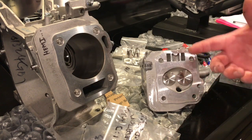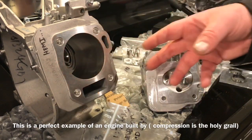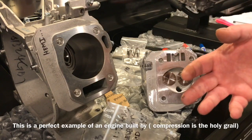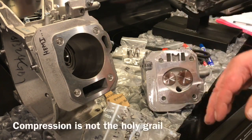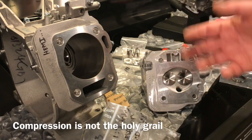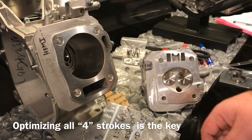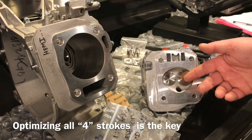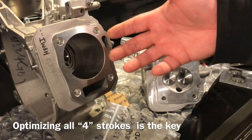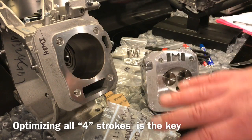Everybody just thinks about flow as air, getting that air and the fuel mixture down into the bottom of the cylinder. That's what gives you horsepower, being able to fill the cylinder, because at a high RPM, basically the engine just runs out of breath. Being able to get that air deep down into that cylinder better is how you create horsepower, because at high RPMs, if it's 10,000 RPMs, 80 times opening and closing per second, with improper cylinder head design, there isn't enough time for that mixture of air and fuel to get down deep enough into the cylinder to create enough power to maintain the rise on the horsepower. So the engine runs out of breath.